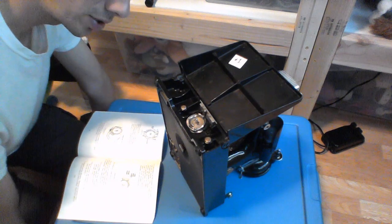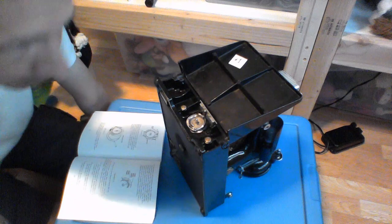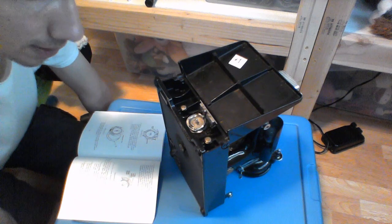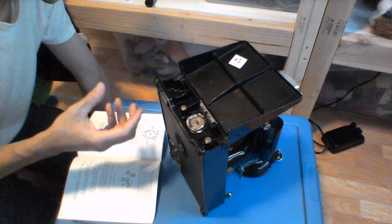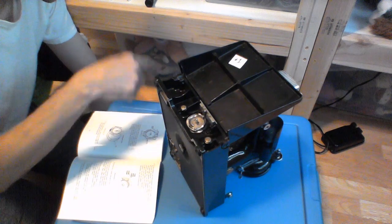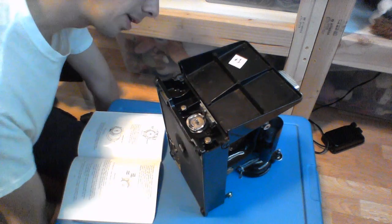These are pretty nice sewing machines. I fixed a couple of things on it now, and it's kind of intuitive, like, yeah, it should be this way. So you think, hey, this isn't working, this belt should run this, why isn't this part working? Well, the belt is working, the motor's working, this is turning, why isn't this turning? Well, it was a jam over here that was causing this.